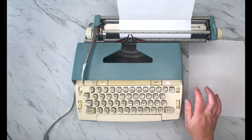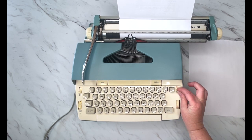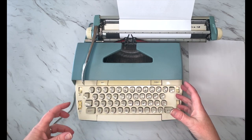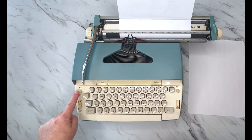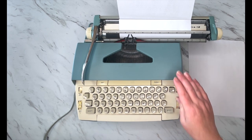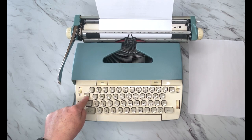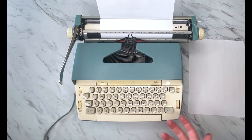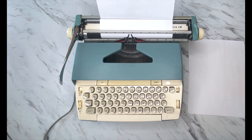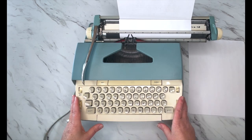We talked about the margin release. Here's your color selector — it's on black, flip it down for red. This is your power switch. Also, if you put this in the middle between black and red, it's not going to type properly. So two things: if something's not working well on your typewriter before you panic, check two things — reverse the direction of your ribbon, and make sure your color selector didn't get bumped and that it's firmly on one of the colors. And then this is your backspace — backspace does not erase, it just backspaces. If you make a mistake, you can X out or dash out. Typewriting is kind of about embracing your mistakes. There is correction liquid you can get at office supply stores.